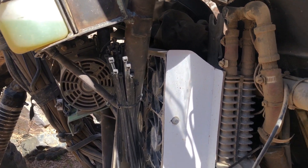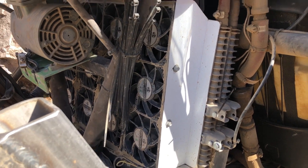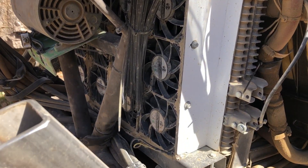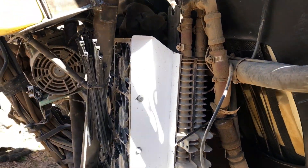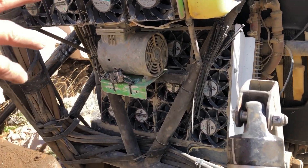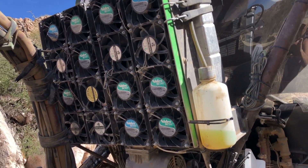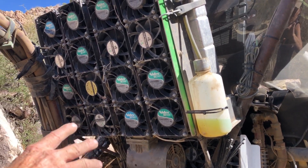I did have to add another set on the hydraulics — same fan, same setup, turns on at 140 degrees. My hydraulics have never gone over 150 degrees working hard going down the road, which pulls harder than any time I'm rock crawling. That's the reason I use these fans. I bought three cases of them, so I've got lots. They're not any more expensive than a single fan, and if one, two, or three quit, it still works.